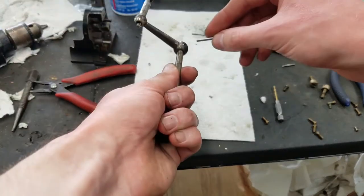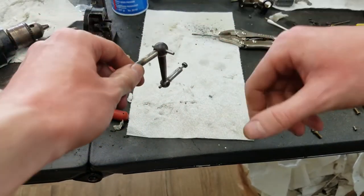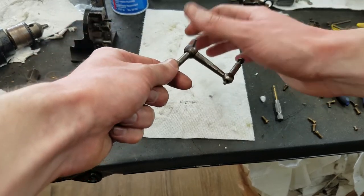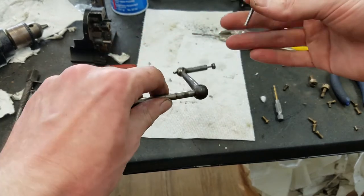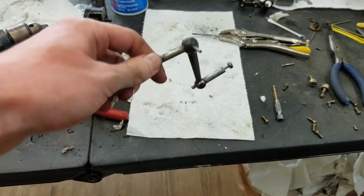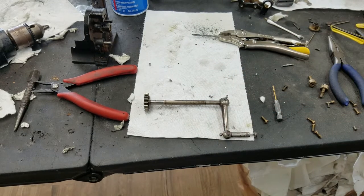And if we put the pin in, it's nice and smooth. And even just with that little push there, it stays in, so the taper is a good fit there. It's a good grab. So yeah, that definitely makes me feel a lot better about that. I have a nice, good, solid pin in there now instead of the remains of the broken one.